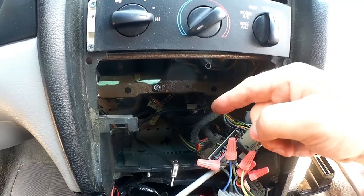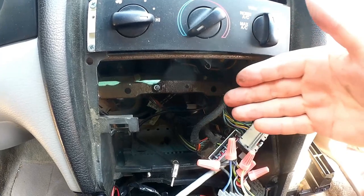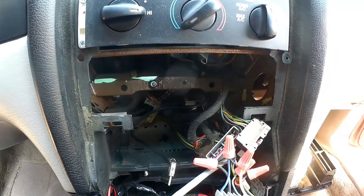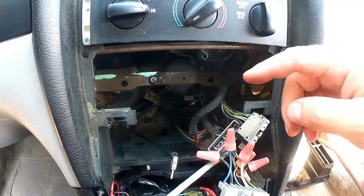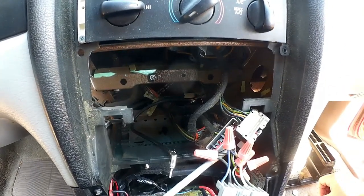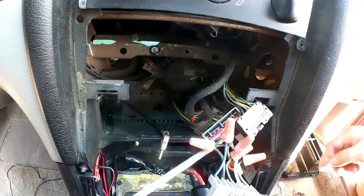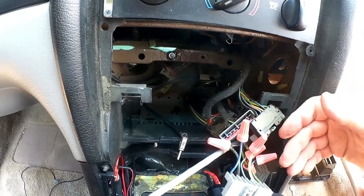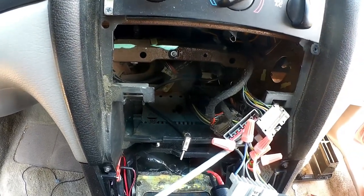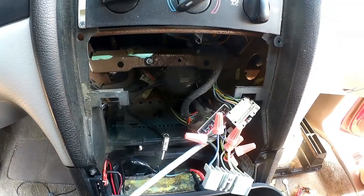But in any case, that amplifier, the one in my 94, didn't actually have an inverter power supply in it. It was just 12-volt rails, which meant it was really 6-volt rails, thanks to the way that electricity works. And so it was no better than the amplifier built into a head unit, really. It was just a product of the era in which it was manufactured, but kind of pointless. So what this represents to me is like 8 pounds of dead weight. So we're going to go ahead and take that thing out of there and eliminate it, because it has no reason to be there. And also eliminate some of this mess of wiring that's in place currently.